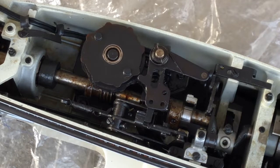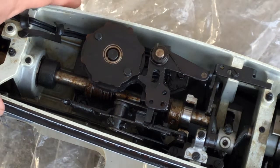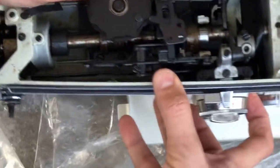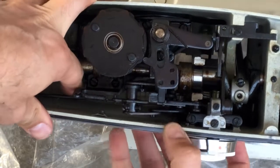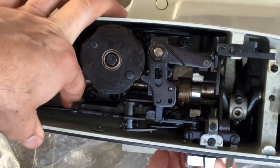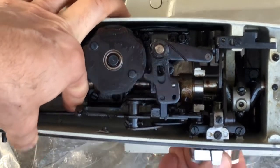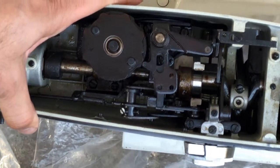I know sometimes it seems like this thing just wants more and more time to unstick itself. So I've been working to see if I could get the zigzag attachment to behave. Let's see if you can see me touching the dial here. There's a lever here that goes all the way over to the needle bar, and that lever wants to move but it's sticking. I can tell when I turn the knob — I've got my finger under it — there's resistance. It should be moving nice and smooth, but it's sticking. And I know that that dial is not strong enough to move the lever because of the resistance we're getting.